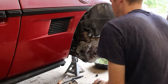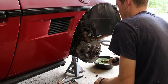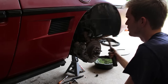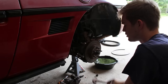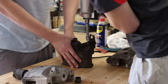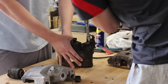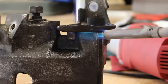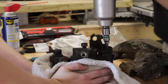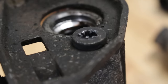The e-brake spring was also taken off back in part one, but I still needed to take off the bracket holding the cable in place. This side came off fine, but the passenger side was a different story — it would not budge at all when it was on the car, so we had to undo the plastic retainer and slide the cable out. We attempted to take off the bolt with our impact driver, but it was not working. We tried penetrating fluid, heat, a stern talking to, but the bolt wouldn't budge, so we just decided to leave it be.